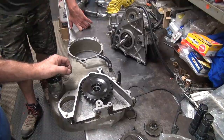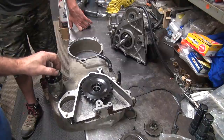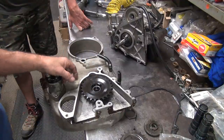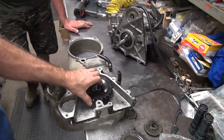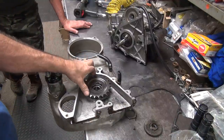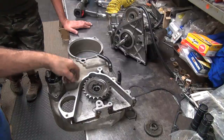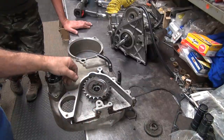Your back wheel was a 46 or 47 — I forget. I know they run them relatively small because they have it so small here to make this work enclosed. There's no way you can run this big one without severely modifying this cover, which we don't really want to do. We can obviously go bigger than this, but even this — it's tight in there. Well, it never hit so it's good. One perk of being enclosed is it would oil — the chain doesn't wear out hardly at all.